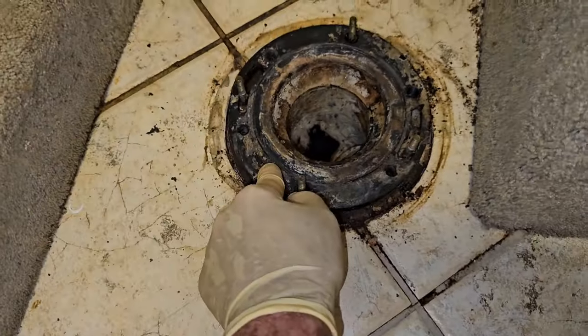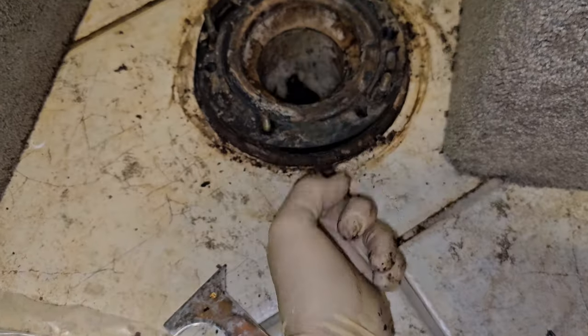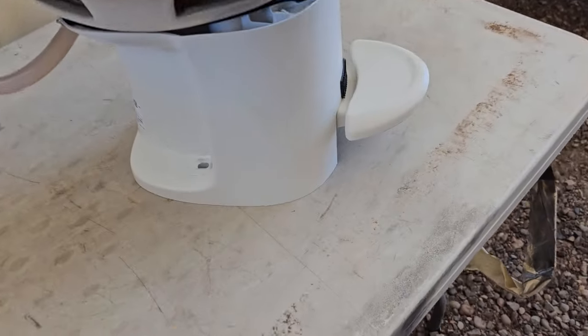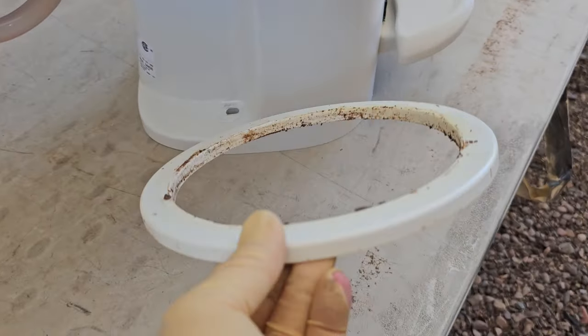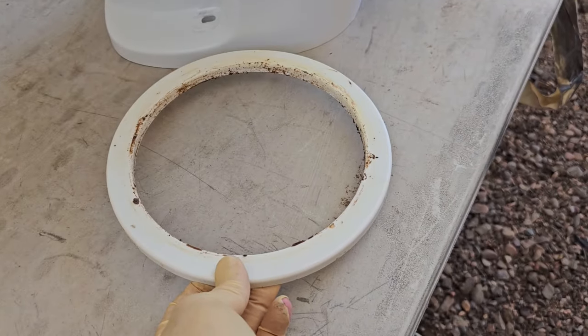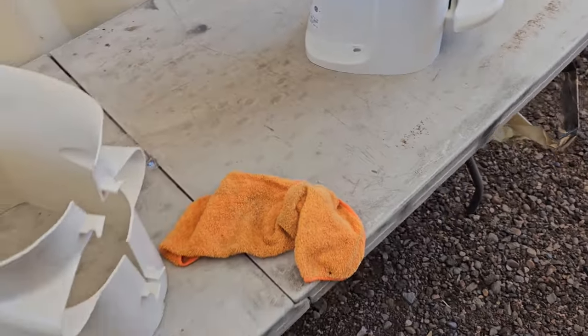I think what we need is this base to be pretty flush with the toilet, or with the tile right here. That way the base of the toilet does come in contact with the tile. We don't want this floating, or resting on just this little spacer right there, because that won't engage the molded plastic underneath there. We don't want a rocking toilet, we already have that.